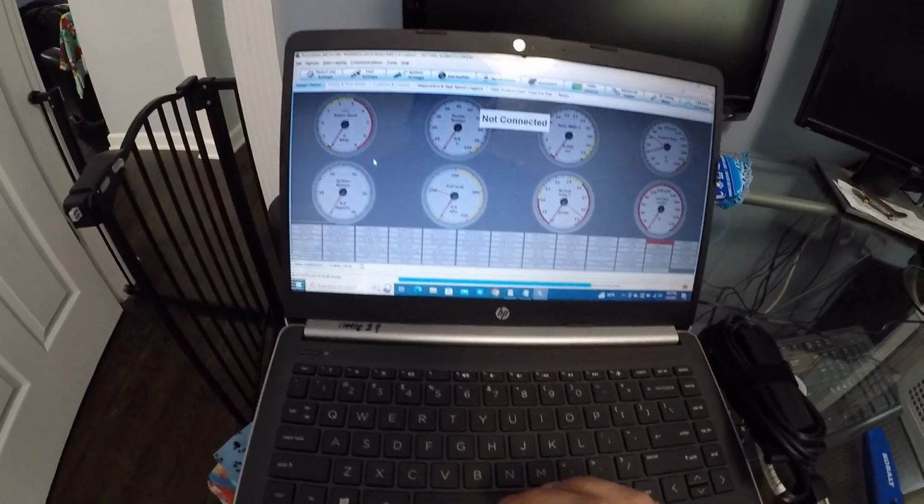Some people gave me some advice. Somebody told me to turn off the VSS settings to help it go into closed loop, essentially. And I have the EGO settings all turned on, PID setting. I've been messing with PIDs, and that's all an algorithm. For a lot of you guys that don't know, it just helps with idling. It's a closed loop algorithm in a sense. It's kind of hard to get into. This is TunerStudio,